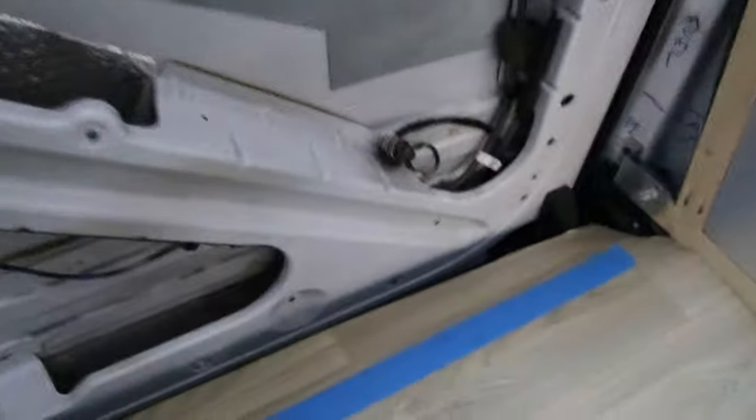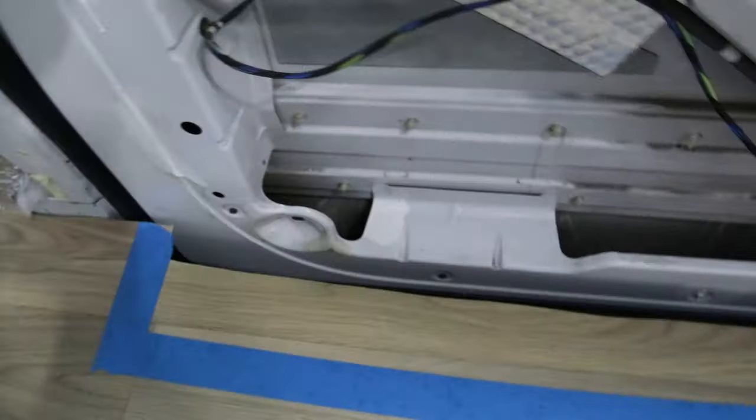We've left a few overhangs where we want to get a more accurate cut, and I've done the same towards the back there. One of the things I've needed to do was to actually bring the van up to the right temperature. Now, warming the van up with all this insulation is actually pretty easy nowadays, but we needed to bring the van up to at least 15 degrees C, and currently in here it is 18 degrees C. So I've had the fan blowing, I've had the adhesive inside rather than in the garage, and that way everything's kind of prepared to go.